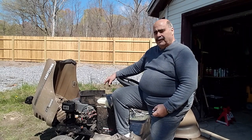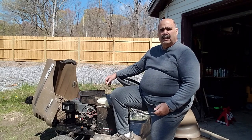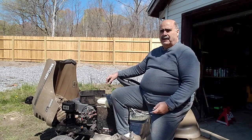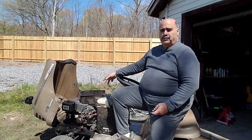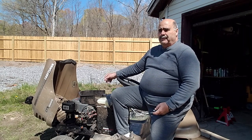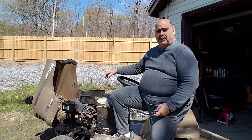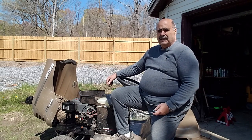This is my Craftsman LT-1000 Lawn Tractor. It's been working perfectly for almost 18 years. I developed a problem the other day — it's been over-revving, and when I start it up now the engine runs away and idles probably about 5,000 RPM, and I shut it down immediately. It's very dangerous to over-rev a small engine like this — it'll literally tear itself apart. The game plan is to take the engine apart without removing it from the tractor, take the bottom over and take the oil pan off, and further diagnose it, which I think is the governor.